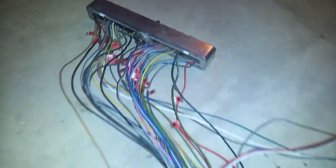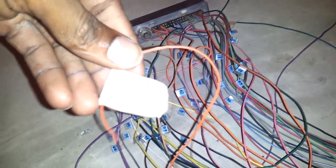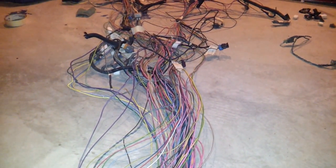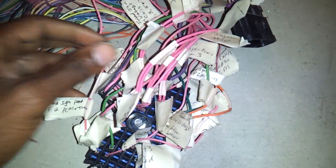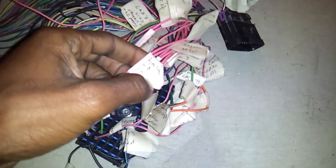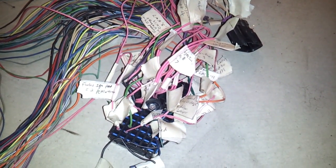What's going on YouTube, I'm back on the wiring. In the last video I added a wire to the red one and a wire to the blue PCM connector to control the fans - I had a computer to control my electric fans. I removed the O2 sensor to show the grounding points and all that stuff on the factory harness. Since then I went and labeled each of these wires on the C2 connector, labeled it on both sides so in case I run into any problems later on down the road, I know where to go back and look.